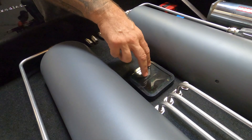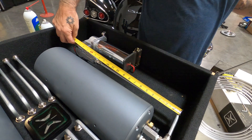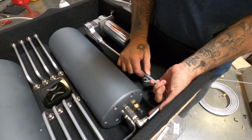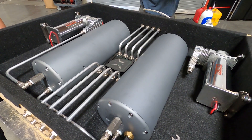We did some nice aluminum hard lines, kind of a cascading four-hard-line kind of deal. We went with kind of like this enclosed box — all the management is inside the box. We got dual endo VT tube valve tanks in there, two three-gallon tanks. We got a pair of ViAir 485s filling them up.